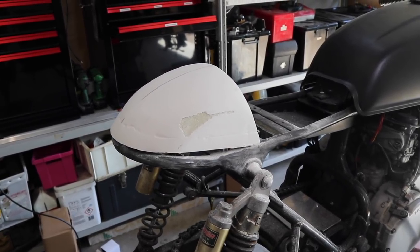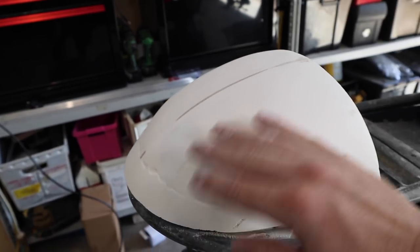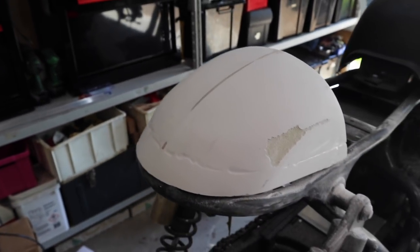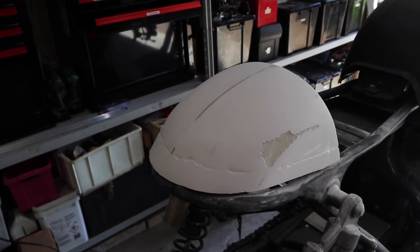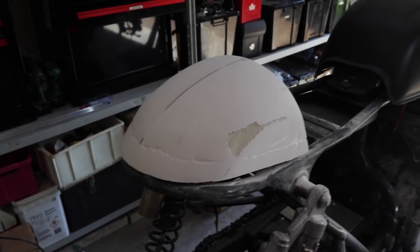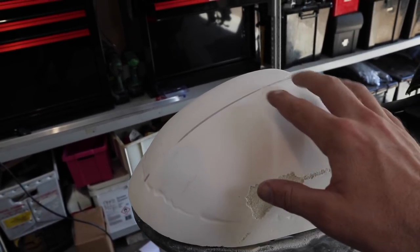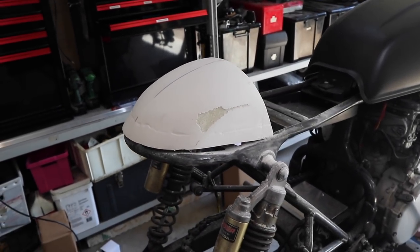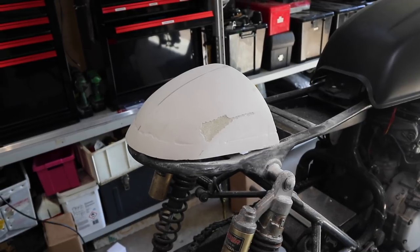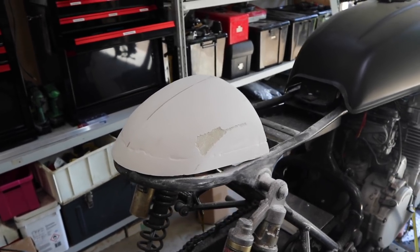And once that's done, final sanding, then I can either put a little bit more of this flow coat over it, or I can just run release agent straight over the top of it. And about six coats of the release agent, and it's just like a car wax. You just let it dry each time and buff it back and do it again, and just do that six times until this has all the little pores and everything completely full. And there's no way that once you put the fiberglass over it, it's gonna stick. It just lets it release. There's no point going through all this process if you don't put enough release agent on, because then you'll be stuck with a fiberglass mold and the plug stuck inside it, which would suck. So yeah, I'm just gonna get stuck into putting some car bog on it.